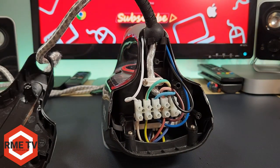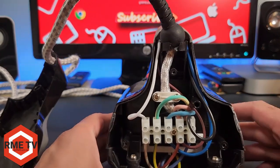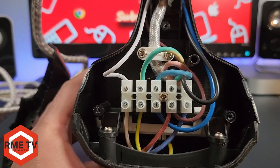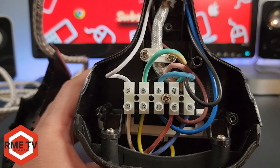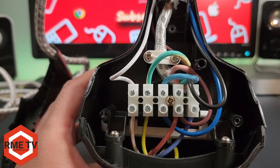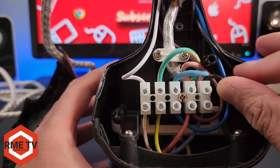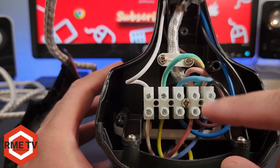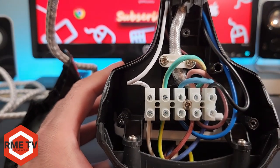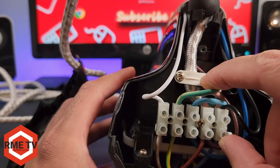It's actually pretty simple and straightforward because we're only going to be dealing with the connections coming into the iron. I'm just going to move this black wire out of the way because that's not something we're going to be touching. We're going to be removing the blue wire, the brown wire, and the earth wire — those are the only connections we're dealing with, and we're only taking the top row of screws off. There's also a little gripper grommet that holds the cable in place so the connections don't get pulled by the wire, and a little plastic sheathing at the top that helps protect the cable.